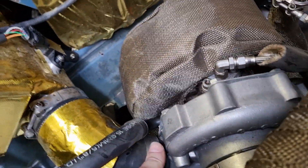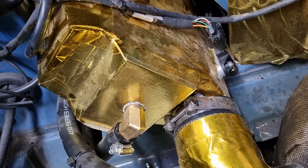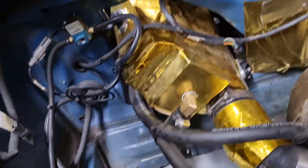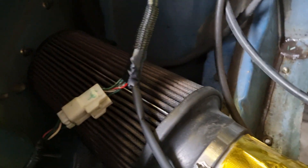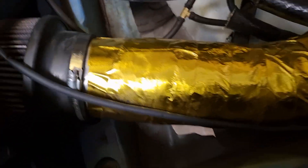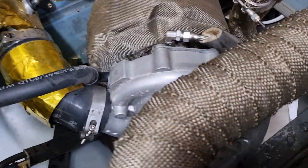As you can see, the outlet keeps expanding into three inch lines that go through the intercooler. It is a four inch filter — rather large — four inch piping all the way into the turbo, which is only a three inch inducer.